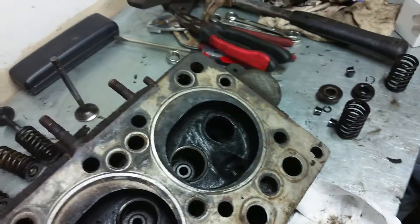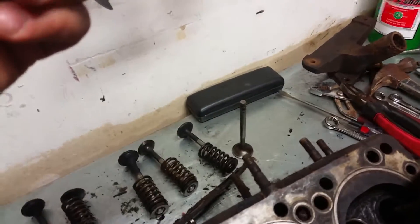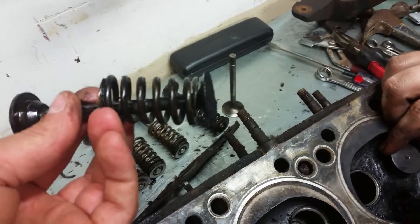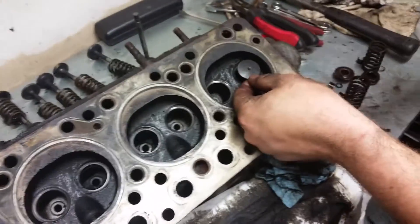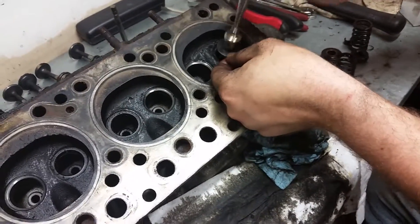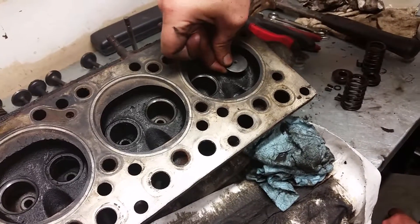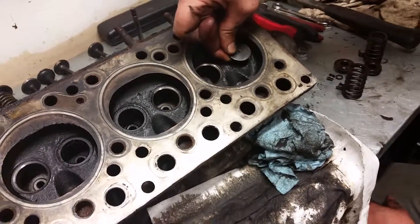As far as the other intake valves are concerned, that one has a little more meat. That one over here has more meat on it yet, so we have a fleeting suspicion that the faces of the valves themselves are worn out from 60 years of running. No magnetic — it's an aircraft, it's made out of titanium. That's a good one — that's a good cylinder that wasn't blowing oil out the exhaust.